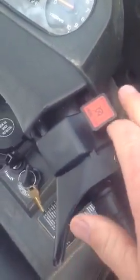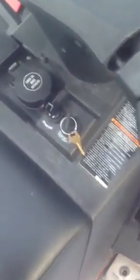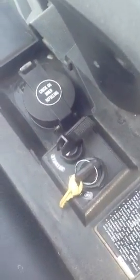I'll have it up for you. You can kill it by hitting it, but it kind of jams, so I'm leaving it up for you. So to recap: start it with choke in full position, turn the key to on, pull the cord, then throw the lever back. Easy enough?